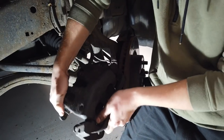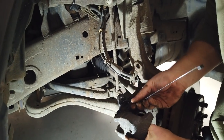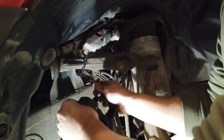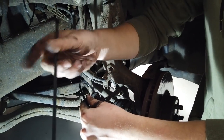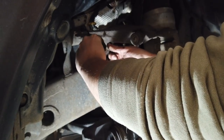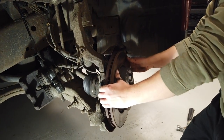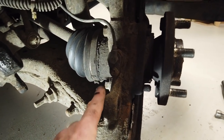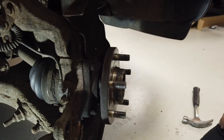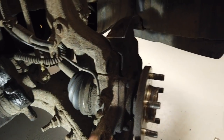Sam always likes to compress the pistons before taking them off, especially if you're going to put new pads on. We've got the pads out. Can you cable tie through one of those holes? You need like three hands to do that - use two cable ties, daisy chain them together. Get that up through there - the caliper's out of the way. The disc should drop off now. That gets us down to the hub. You can see quite nicely the hub bolt going through, and judging by the amount of grease over everything here it looks like the bearing has been leaking and spewing grease everywhere.